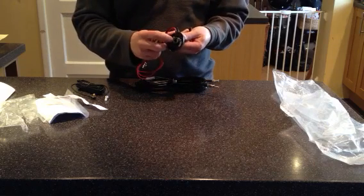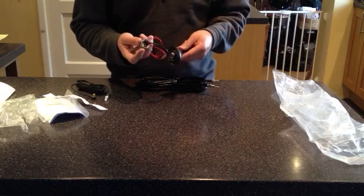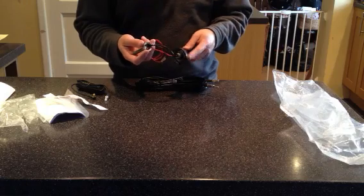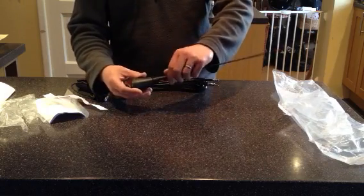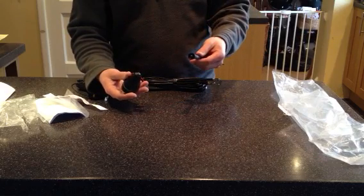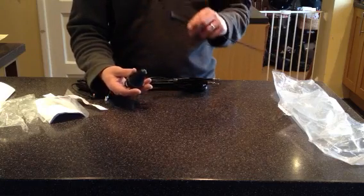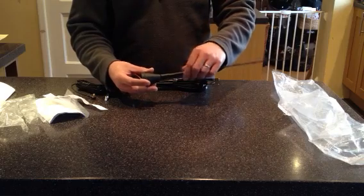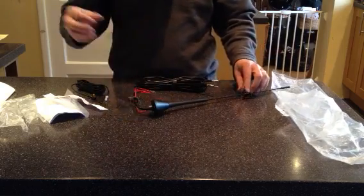And don't forget you've got the rubber mounts here, make sure that they're on there. Also make sure that this clamp here gets a very, very good connection because that will be your negative connection for the power supply within the base itself. The aerial does also unscrew, so if you find yourself going into a car park or you have issues with vandalism, you can purchase a new one of these antennas, or if you wish, when you park up, you can remove the antenna, stick it inside your car, and therefore alleviate any vandalism potential problems.